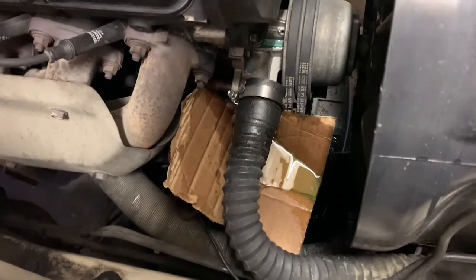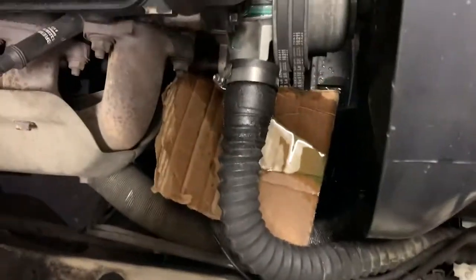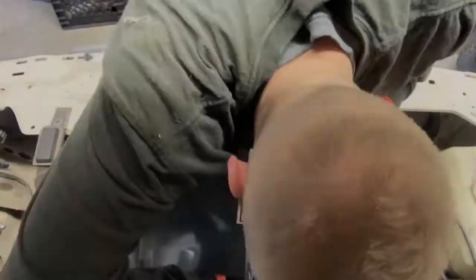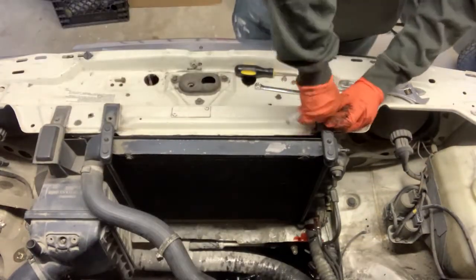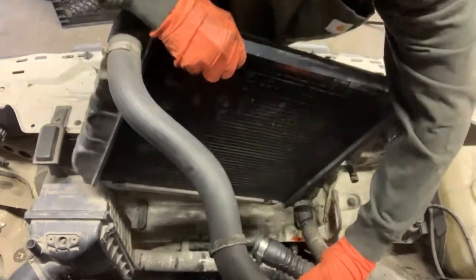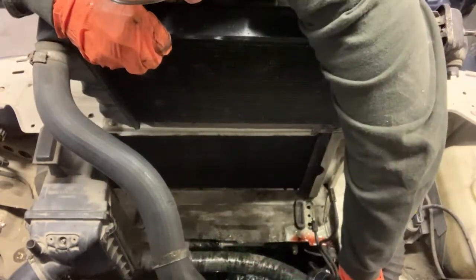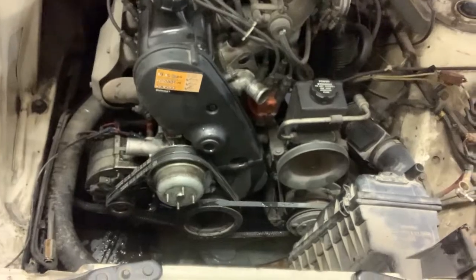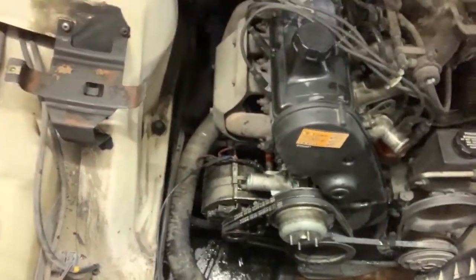For the coolant, put some cardboard down. Pop off the lower radiator hose from the water pump and let it drain down. The fan shroud is loose and the fan is loose, so it should be able to just come right off — just like that. Got it all out: radiator, fan, fan shroud. Got the coolant reservoir removed and the battery is removed.